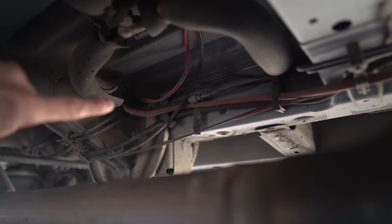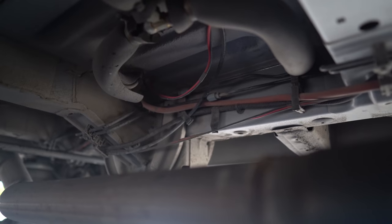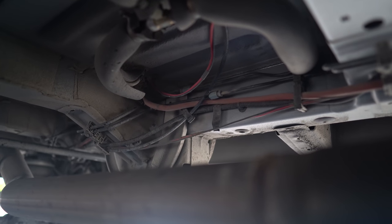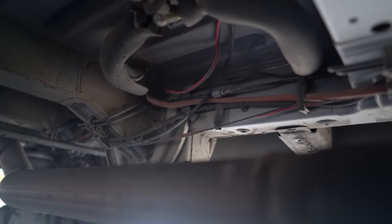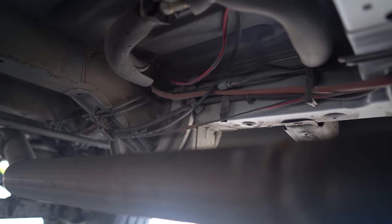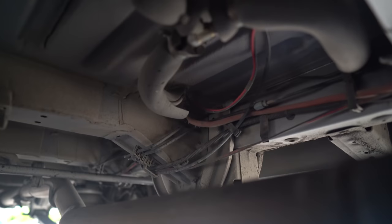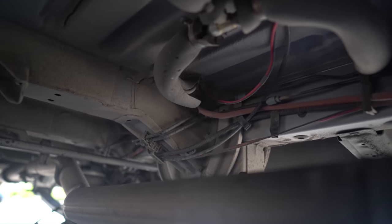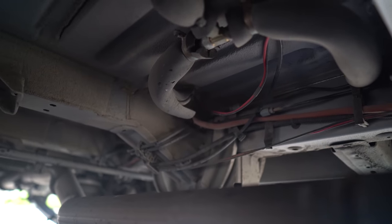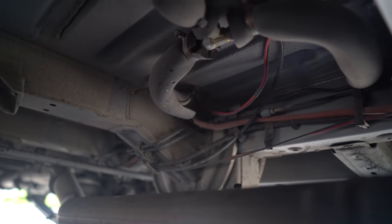This red cable here that runs into the van by the propane is what goes into the battery bank. That is our auxiliary charging system. It runs off the alternator, so when you start the van, it starts sending electricity and that'll charge your auxiliary battery bank. There's gonna be a link to that in the description as well. That's pretty crucial if you're somewhere where you're not getting any solar power. Example, somewhere where there's a lot of snow, or somewhere where there's a lot of high mountains around you and you only get a short burst of daylight each day, you're gonna want something that's gonna actually send electricity to the battery bank other than your solar system, and one of these smart isolator switches is the easiest way to do that.